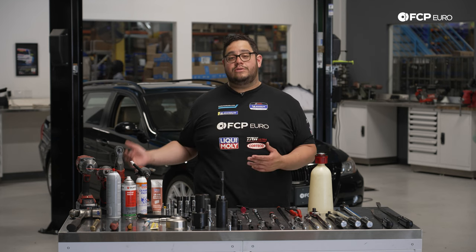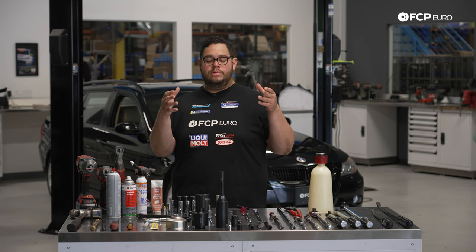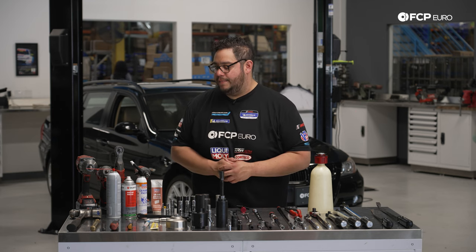Today we'll be using a combination of a trans jack, maybe a screw jack, depending on how crazy we get. And for setting ride height on all these things, when you drop your subframe, assuming you're dropping the hardware at the subframe itself, meaning the inside control arm bolts, you need a couple blocks of wood to set the car on all fours so you can tighten everything at ride height. If you're taking everything apart at the ball joint end, you don't need to worry about that.